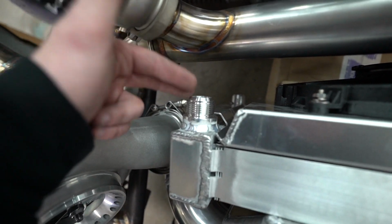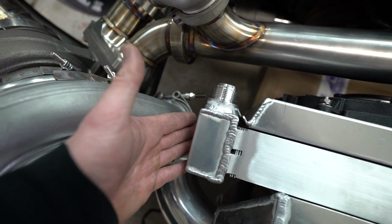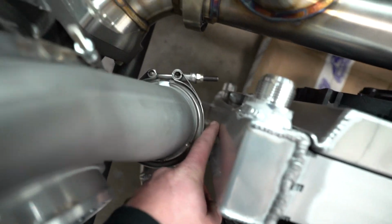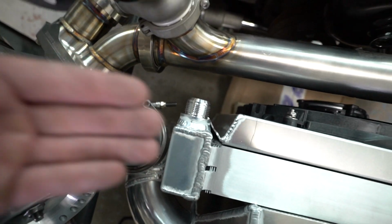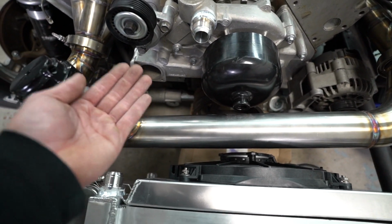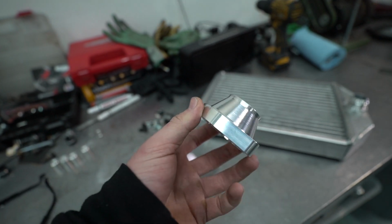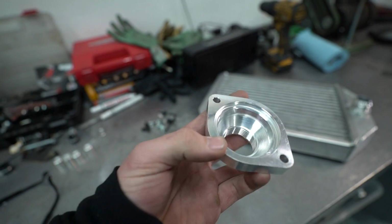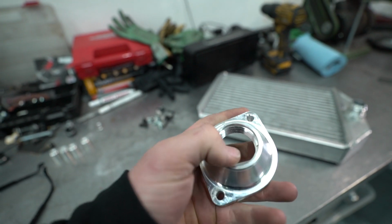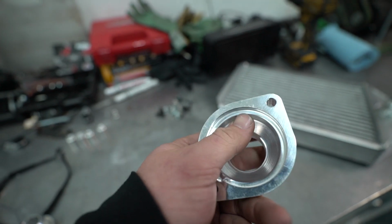Also got the dash 16 bungs welded on the Sirocco radiator as well. This is a split end tank setup, so right in between here, down in the middle, it has a tab, so that way it has to flow this way and then back down and around and then back into where the thermostat's going to go. This is my next thing. This is the little AN thermostat housing from Motion Raceworks. It's made to have a threaded piece thread into here, and it has a little bit extra clearance for the thermostat to sit in here.